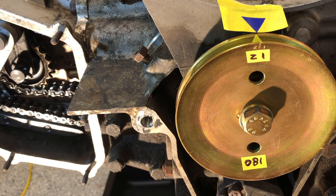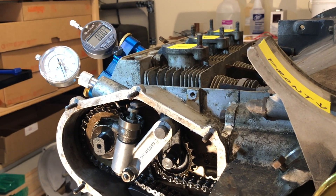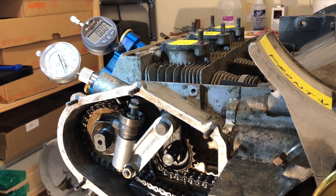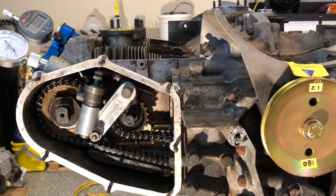Now with a good understanding of our crankshaft rotation ratio, let's take a look at how it works in relation to number one cylinder, which is our starting point for all this cam timing. We're going to figure out what events are taking place inside the engine as we roll through all four strokes. Let's do a quick review: we have intake stroke, compression stroke, combustion (or power) stroke, and exhaust stroke — all broken down within our 720-degree rotation.